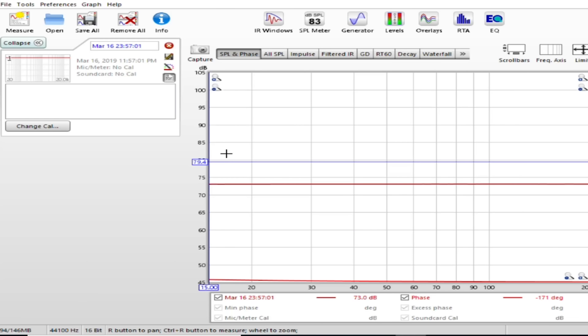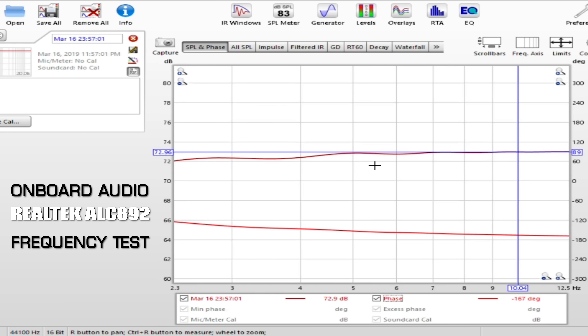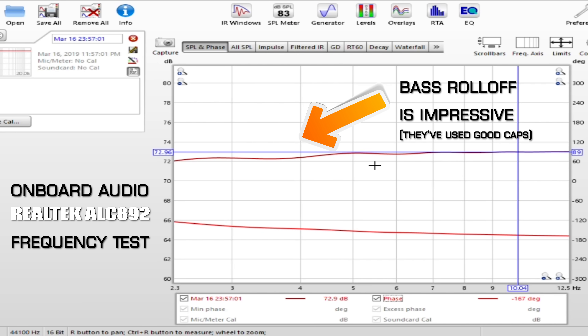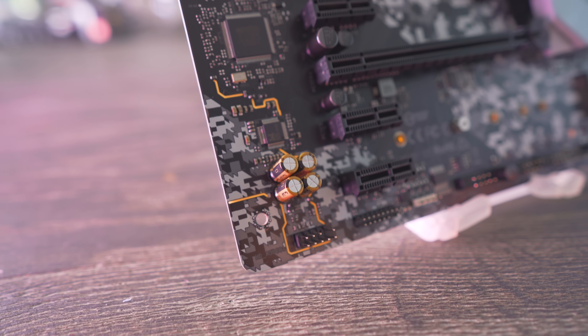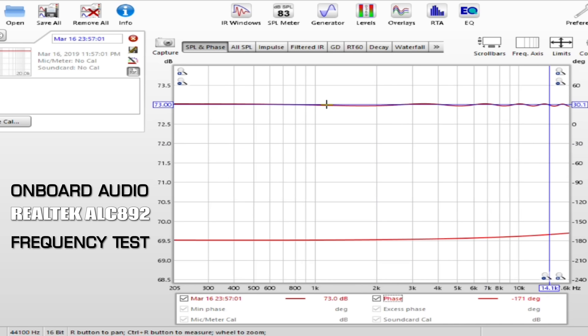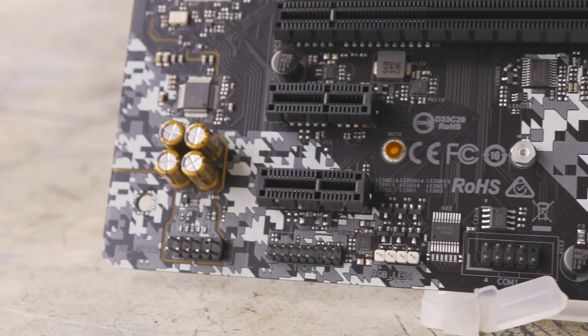The audio is where things get very interesting for the B450 Steel Legend, simply because they've used the Realtek ALC 892, which is lower in number than the ALC 1220 — you'd probably think it's inferior. And yes it would be, but when I put it through all the stress tests it performed phenomenally well; it's some of the best onboard audio I've seen. That's thanks to the Nichicon Gold Caps used on the onboard audio solution. You can have the best DAC in the world, but if you've got poor components connected to it, your audio will sound poor. Here they've used a relatively good codec coupled with good componentry, resulting in virtually no drop-off below 10 Hz — less than a one-decibel drop-off — meaning your bass comes through very clearly on headphones or analog out speakers. Moving through the frequency response curve, it was relatively flat the whole way through.